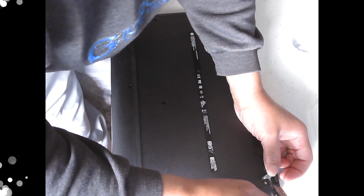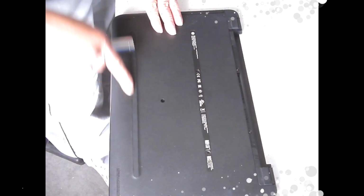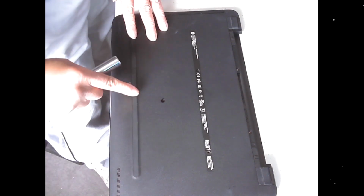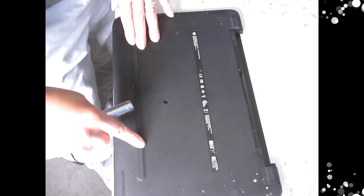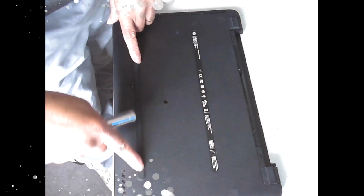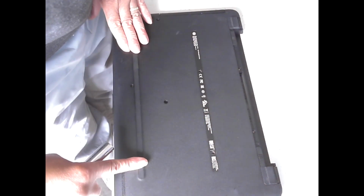So when you take these laptops apart, a lot of them have hidden screws. I thought there was some under here, but there wasn't. And some laptops you've got 2 rubber strips like these. This is what, you know, the feet that stops it sliding. There'll be like 2 of them. And under there, when you lift these up, there will be hidden screws. You'll see some screws on the bottom. You'll see these hidden screws.